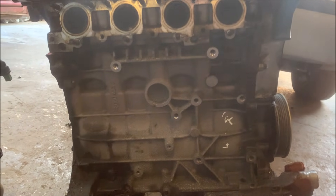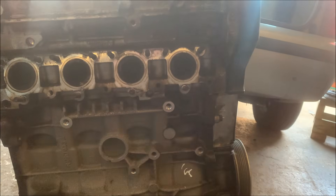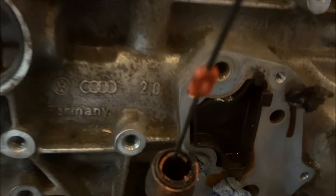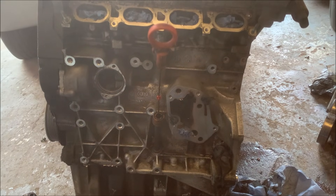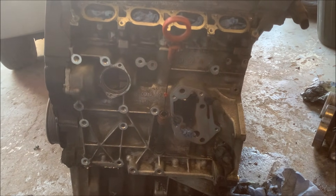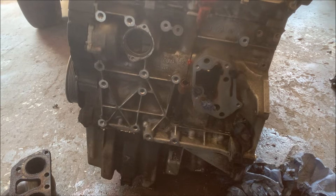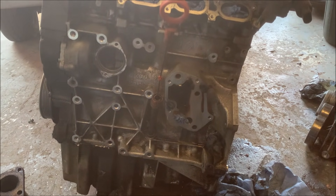Better look at the block - just an alloy block. I think that's where the turbo pipe normally goes, blanked off on these. It's a 2 litre 20 valve big port - but is anything interchangeable? Is the head the same? I know the VVT is different, doesn't mean it's not interchangeable. I'm going to have to take the head off and have a look. It's got balance shafts in the bottom end which I don't want, but you delete them anyway. It's like some weird mish-mash hybrid of TFSI and a 180.